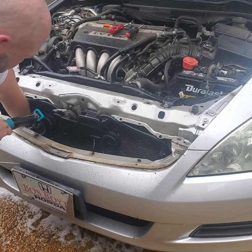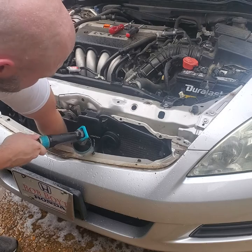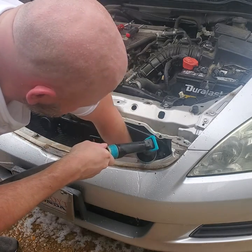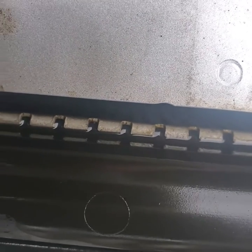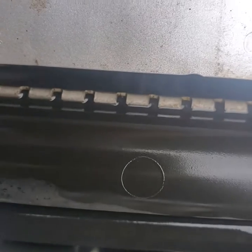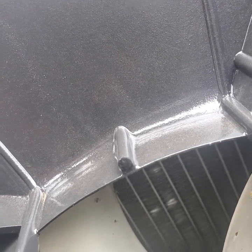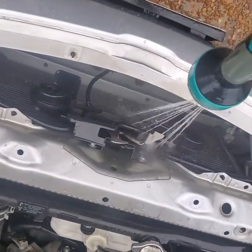Now I'm switching back to the front, still using water, and I'm using my hand to lightly brush and scrub the condenser. I'm using my hand because I don't want to damage the fins. You can see water flowing in between the condenser and the radiator — if water can do that, you know air is able to get by and the cleaning is actually working. You can also see the water getting through to the radiator from spraying the front of the condenser, so that's good and it means it's working.